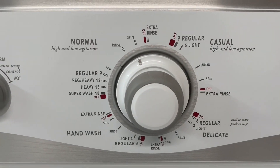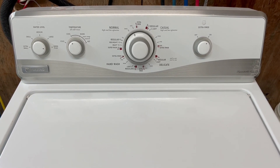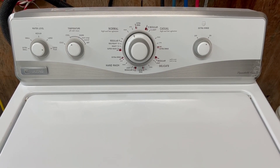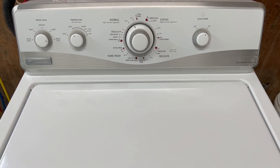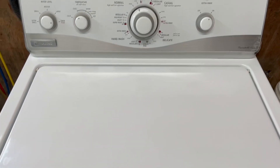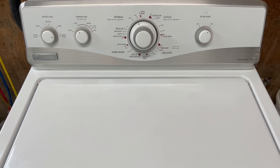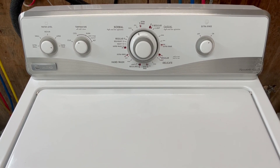Okay, we're on the final spin cycle — it's up to just about full speed. See, the machine is nice and smooth, sounds great. I'm going to lift the lid up to show you that it is in fact spinning at high speed. It's going to put the brakes on and stop because of the lid switch — it's a lid switch that knows if you open it, it's going to shut it down. But you'll be able to see that it is in fact spinning nice and fast. Sounds like it should be at full speed, so we'll go ahead and lift it up.